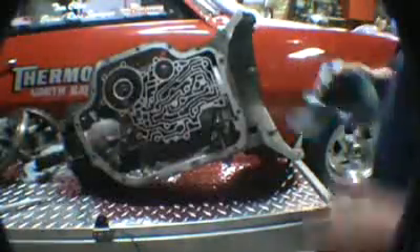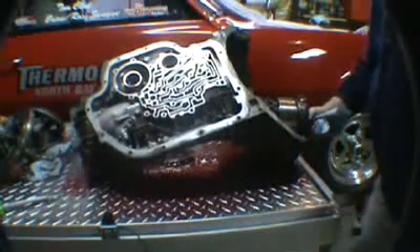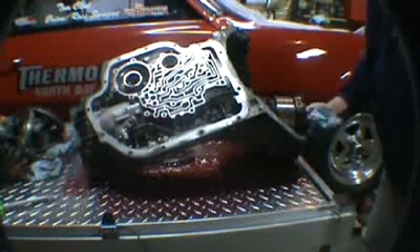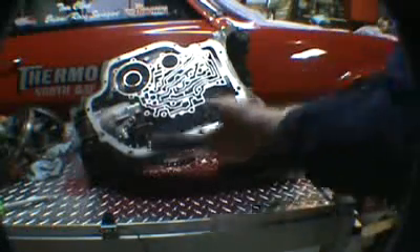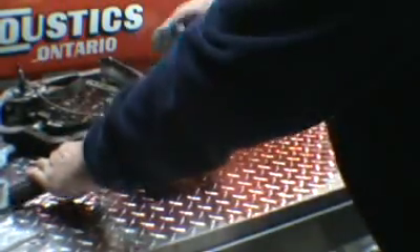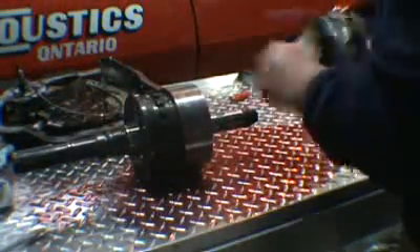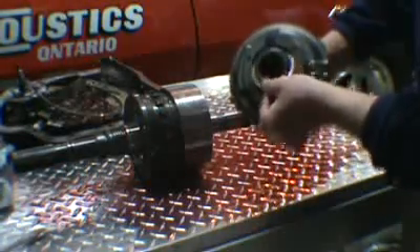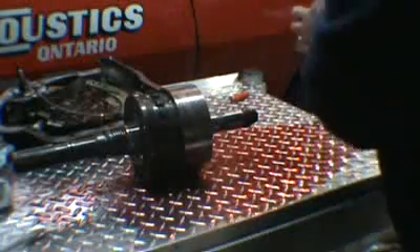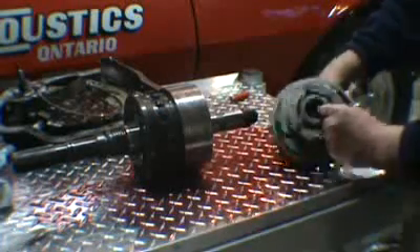There's no ring around the housing. At that point you can just go ahead and pull the whole gear set — everything out in one shot. Then we can go ahead and just take that center support off. See, there's a washer that goes in down in here. Then there's a Torrington bearing also — you can see the race right here.